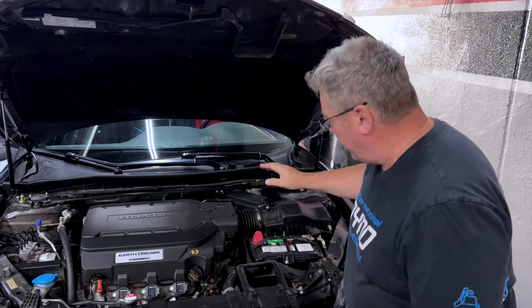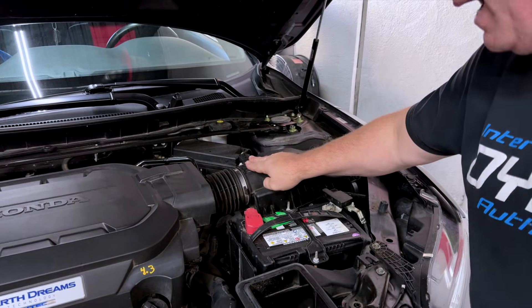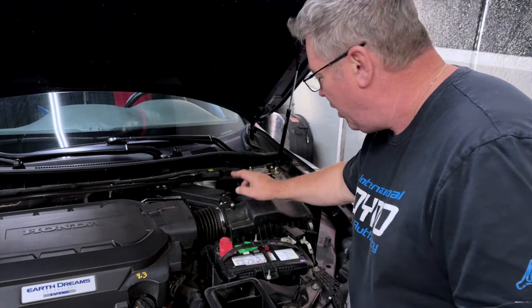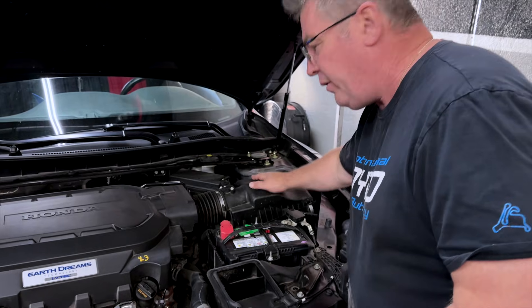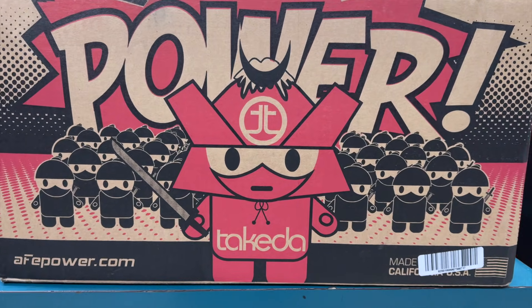Under the hood, what we're going to be replacing today — to give this a nicer, straighter shot — is a performance cold air intake. We're going to be replacing this part of the intake, removing the MAF sensor and replacing it back into the cold air intake, removing the box, putting in a divider, and then putting a high flow air filter into it as well. The Takeda is made by AFE and made for Honda. We'll replace everything that's there, show you the process, and then come back and run the test.